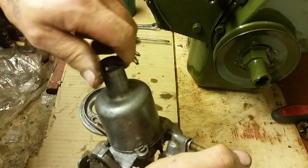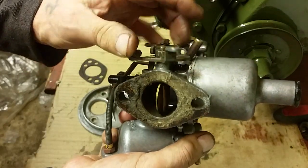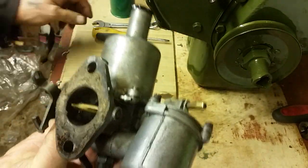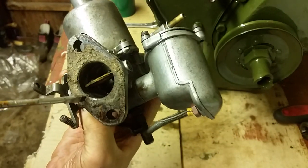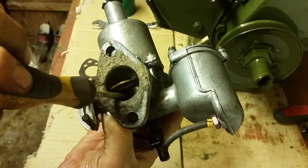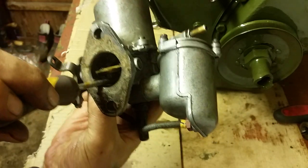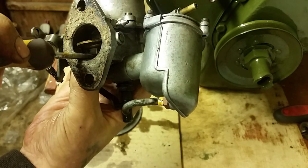And what that plunger does, it stops the carburetor surging. If I open that carb up, where the brass needle valve went in, it goes down the bottom, and the bottom of that thing lifts up. When you're driving, the air gets through, and it lifts that body up inside, and that spring stops it from just bouncing right up and down.